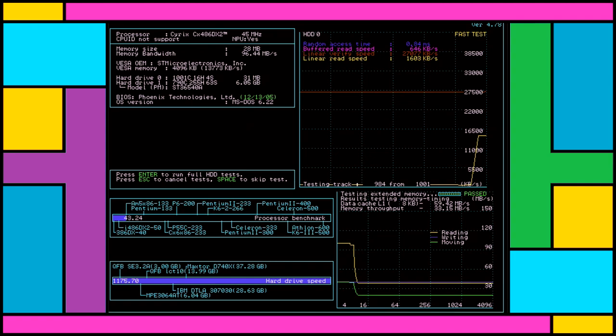It's fairly close, and they're both within the ballpark, comparable to a 66 MHz Pentium at this point. Things are similarly close with the memory bandwidth: 96 against 100. There's basically nothing in it here, which is kind of odd because the ECS board and AMD processor have to use EDO memory — and even then, I measured no advantage over fast page memory. Arbor do limit the timings on this board pretty hard in places, so the SD-RAM maybe can't always give you much advantage.